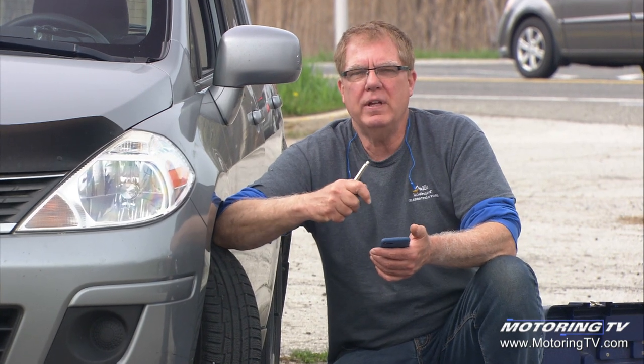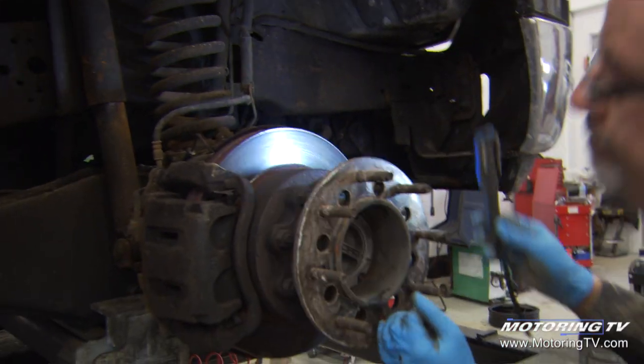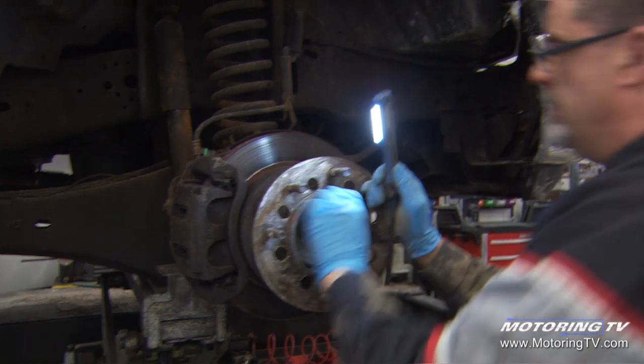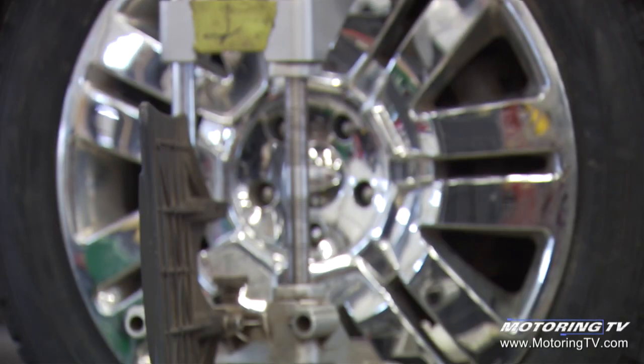There are certainly a lot of things where you can make a case for doing a wheel alignment. Everything he's described, though, points to the fact that this car probably doesn't need one. However, without taking the actual readings or looking at the car, can we say definitively that it doesn't? No, we can't. So the proper way to handle it would be to check the wheel alignment.